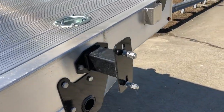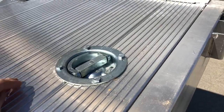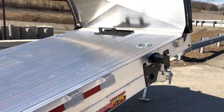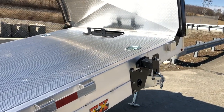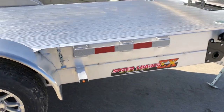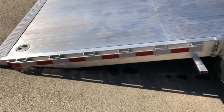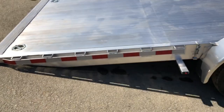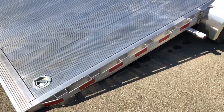We have added a spare tire mount to these. This has four of the deluxe D-rings — these are a swivel ring rated at 6,000 pounds. We've used those instead of the cheaper traditional D-rings. Swivels just give you some extra versatility. On this we've added a few extra stake pockets. The stake pocket centers are generally a little farther apart. I believe we've added maybe one each side in front and two each side in the back over what is standard. Gives you some extra tie-down points and also stiffens up that rub rail.